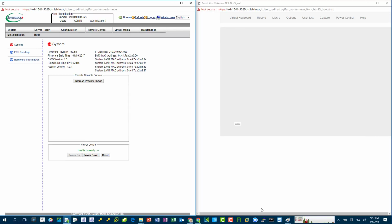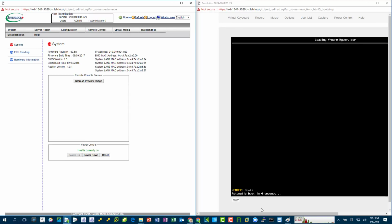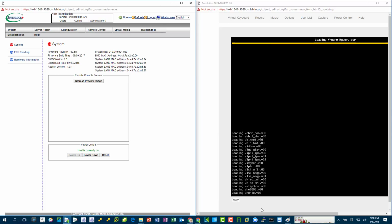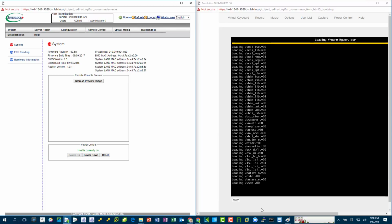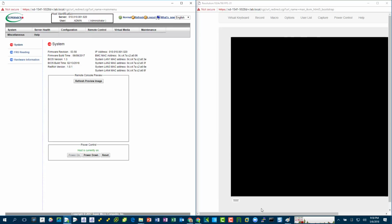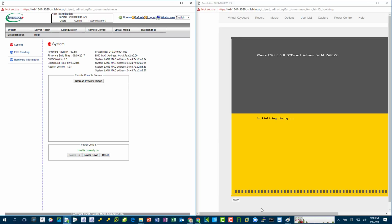And the speed of it, by the way, whether it's USB 2.0 or 3.0, it never mattered to your VMs. Your VMs don't care. ESXi hypervisor just loads into RAM. There's very little write activity on the bootable media. There is an exception for larger vSAN installs where you're going to want to use M.2. So more modern servers, you'll have M.2 mirrors, RAID 1, pairs of M.2 gum sticks, NVMe or SATA versions. Those are kind of slow, but they're affordable and have much more write endurance for some environments where you actually will be writing to that media a little. Way more reliable than SD.